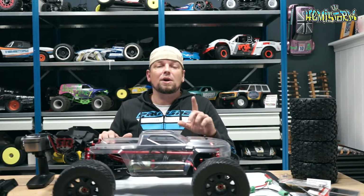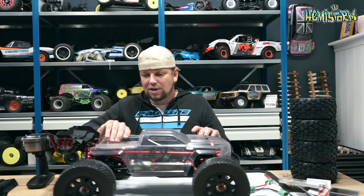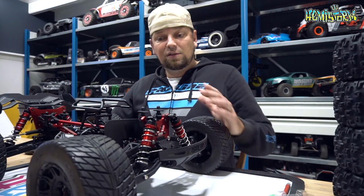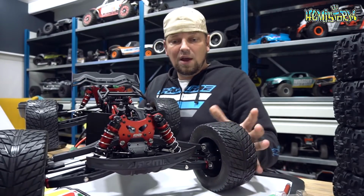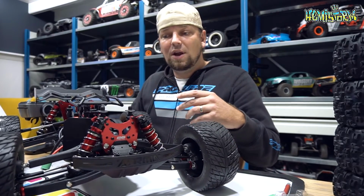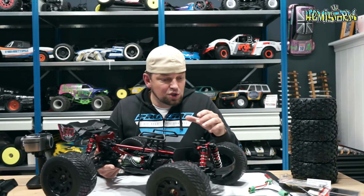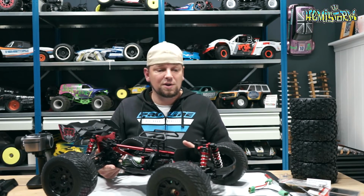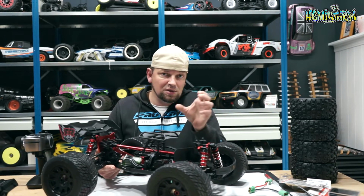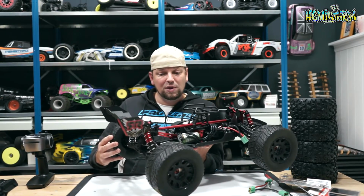Another thing that I will link over there is a video made by Razor RC, from the top of my head. He has a really nice guide to shimming your diffs. I know that in the last video I mentioned that some of the diffs in the Kraton EXBs had some problems, and of course avoiding those problems or solving them immediately rather than a problem really developing is advisable. So what Razor RC shows is that it's really easy to pull your front and your rear diff, and how to shim them. In my case, I only needed one tiny shim in the front just to get the slop out between the ring and the pinion gear, and one shim in the back just to get the slop out between the spider gears.